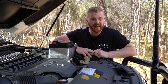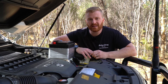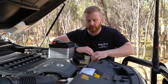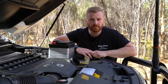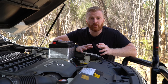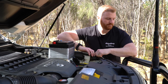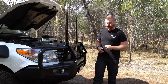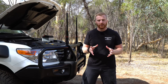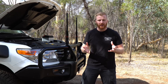I also contacted iTechworld directly to see whether they had any solutions, as I'm sure there would have been previous customers with a similar issue. They got back to me very quickly and provided a recommendation for a Victron Smart Connect product, which is similar to a relay but is a programmable unit that would disconnect the vehicle line from the cranking battery to the Redarc system at a pre-programmed voltage. The advantage of the Victron product is that you can manually program what voltage you want the battery to disconnect from the Redarc system. I was very impressed with both companies and their ability to quickly and efficiently provide solutions. I'm yet to have either solution fitted, hence the AGM is still in the Cruiser, but I'm leaning towards the 50-amp heavy-duty relay as suggested by Redarc, and I'll keep you updated on social media.